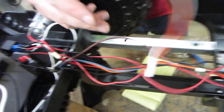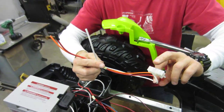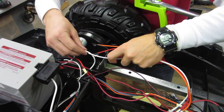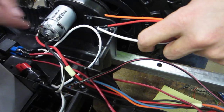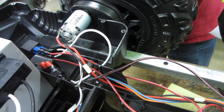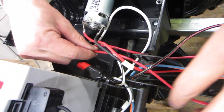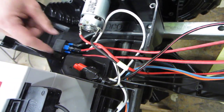That line right here on our pigtail on our switch — once you took that out we don't need it. So you can see we cut that same wire, looped it around, and took it into our relay on position number 30. Then the last one, number 86 on the relay, runs all the way along the car.